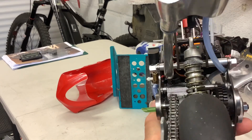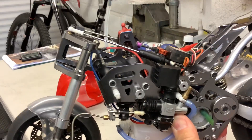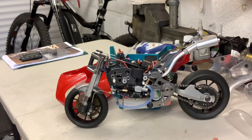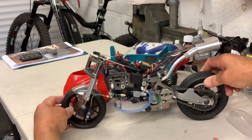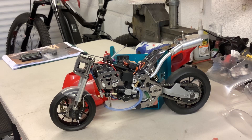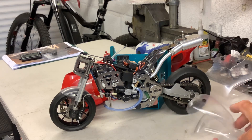I'm really pleased with it. I'm hoping we get good weather this week because it is a great thing to drive. The second gear just adds another dimension to the model. It doesn't sound noisy - it sounds really spot on. To see it pull the front wheel in the air when you drive away is really good. The back brake works quite well too - it's only got gasket paper for brake pads, not fantastic, but not too bad.